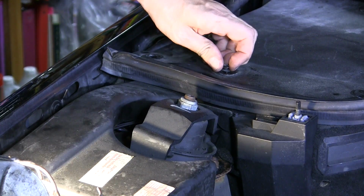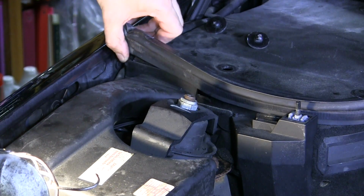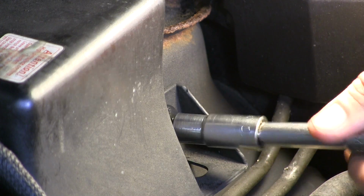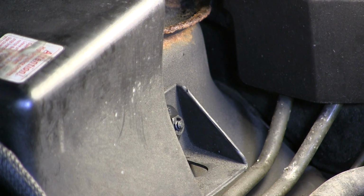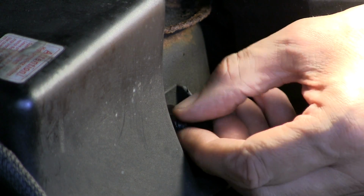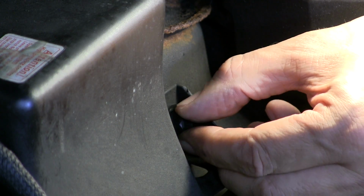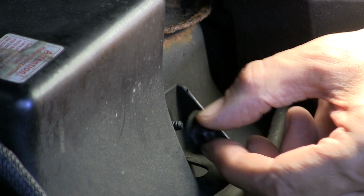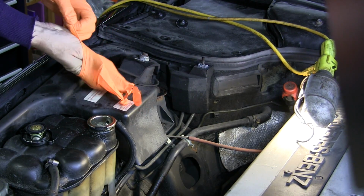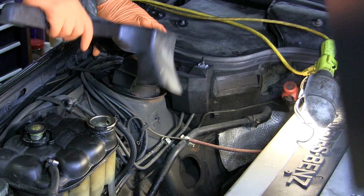To get at the tank mounting lugs on the wheel well, I first had to loosen the plastic cover that houses the relays by removing 2 Phillips head screws. On the side of the cover facing the engine, there is also a 10mm plastic nut threaded onto a stud just behind the tank. I knew that everything from here on out was going to be pretty grimy, so I put on some gloves before I lifted the whole cover out of the way and set it aside.